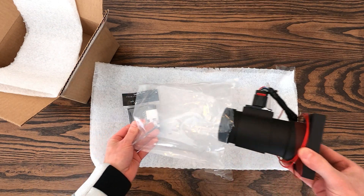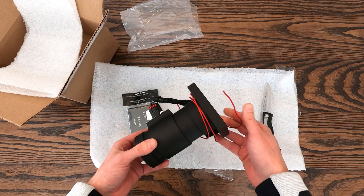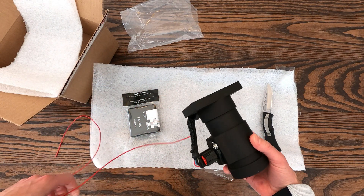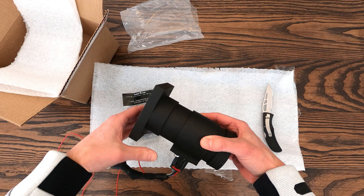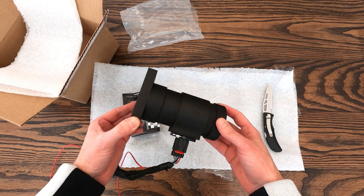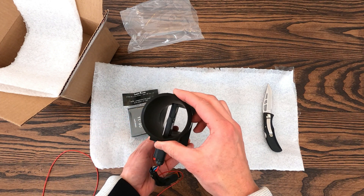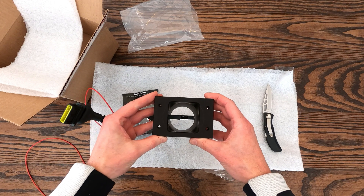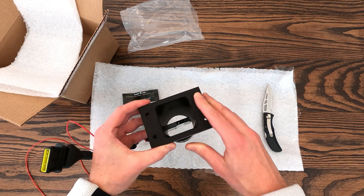We'll also find in here a newly redesigned CNC machined intake tube made from 6061 T6 aluminum that has an anodized black finish for corrosion protection. This is the piece that replaces the existing airflow meter on the car, connecting the intake J-boot on one side of the system to the air filter housing on the other side, and it bolts right up to those factory components.